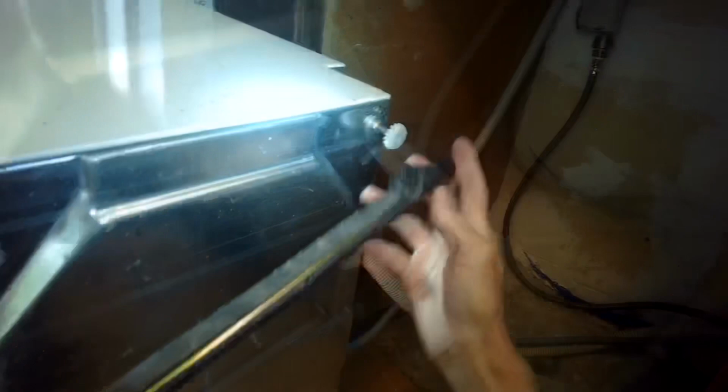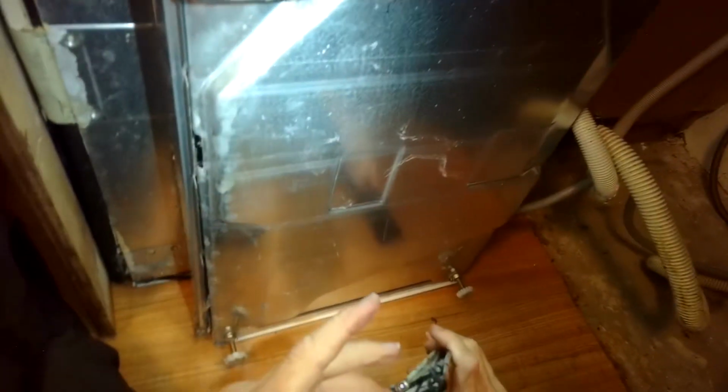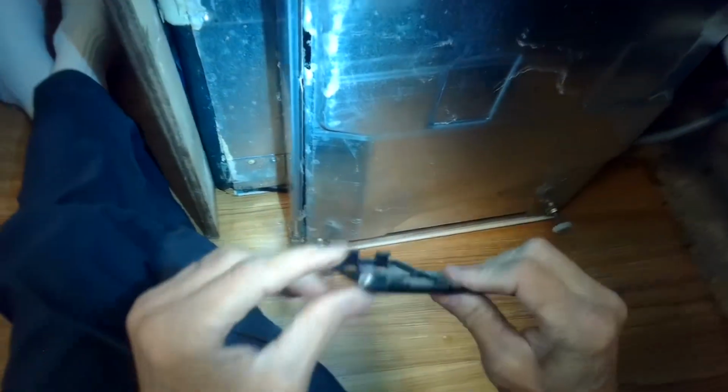Back on. So this just fits over these wheels. That helps you to adjust those. And we have one over here. So this screw has to be pointing out toward the front. Got it. Okay. Put it on its feet. So the circulation motor sounds really good after replacing the capacitor. We'll see if it can do the whole cycle now and not give up near the end.